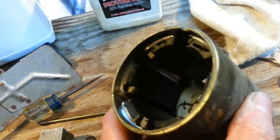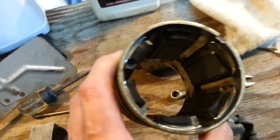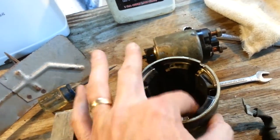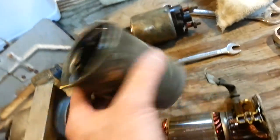A lot of people, when they've got something on a car that won't start, they reach under there with a hammer and tap the side of the starter. Well, the reason you never want to do that is because you have ceramic magnets in here and they're glued in place. If you hit that with a hammer, you're going to break your magnet and you're going to have all kinds of trouble. So don't do that.